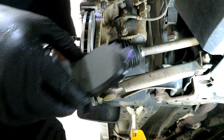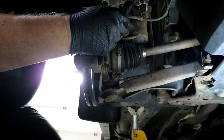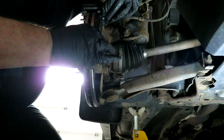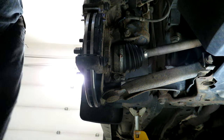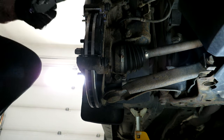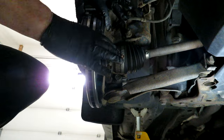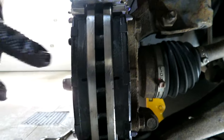I put a bit of lube on the end of my brake pad tabs or guides and we'll slide them into the new caliper guides — that's the back one. I've got some lube on the front one too, and you just sit it in there like that. You can see them lined up in there: new rotor, pad, pad. Now we'll put the caliper on.